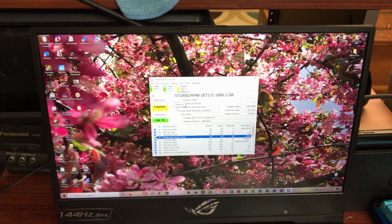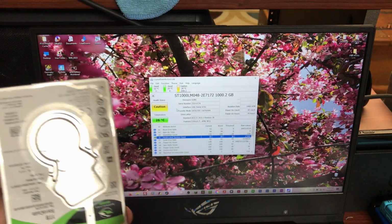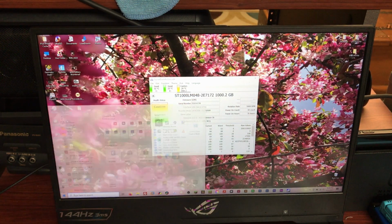Basically, imagine you can see the circle thing, that's the center of the platters. The head arm is right here, or it might be right here on this drive. Pretend it's right here. Basically, it goes and seeks on the platters. And that big loud noise you heard is it thunking back to the start position and slamming against the stop. Sadly, it didn't go up, the reallocated sectors count. Nice verbal typo there. Hey, I'm not good at spelling.